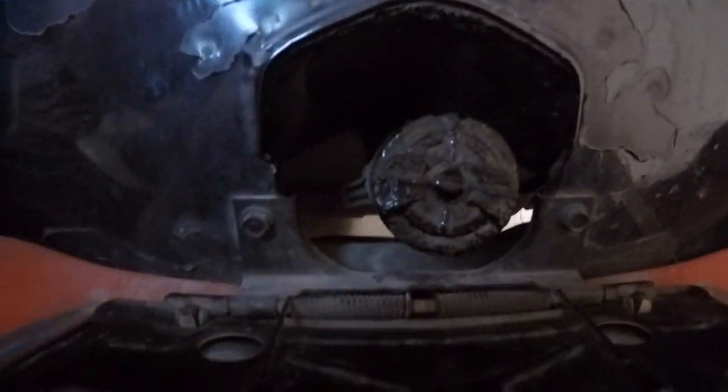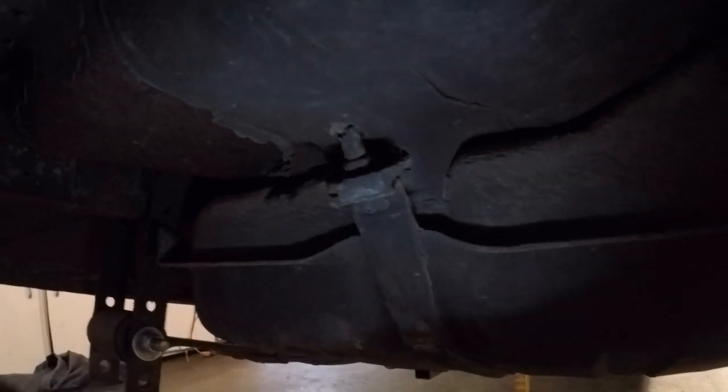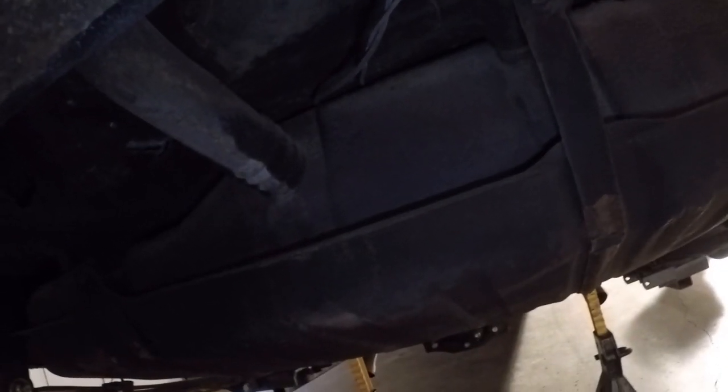The fuel is fully drained, so next we take out the tank. You see that little bracket going to the bumper right there on the bottom? There's a bolt right here - take that out and that'll make this filler neck loose. Then under here we have one strap and two straps. These wires look like sending unit wires. If I just get these straps and this filler neck loose, I'll be able to drop it enough to get the fuel lines off.